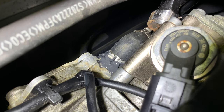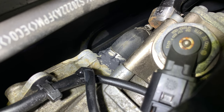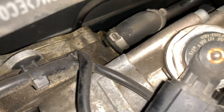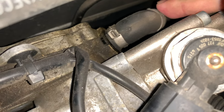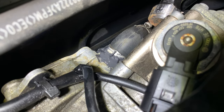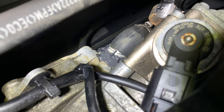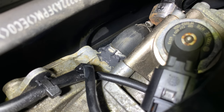Hopefully we will never get that knocking again. I only heard it when it was cold, and it has been cold lately. If you hear something that really sounds like knocking valve noise, it doesn't mean you don't have that too, but in this case that's what it was — the hose moving around quite a bit. So there's your fix: five dollars of JB Weld and a few minutes of your time. Check it out for Audi A4 B7 models at least. I'll put a link to JB Weld in the description if you want to pick some up. Peter Von Panda out.